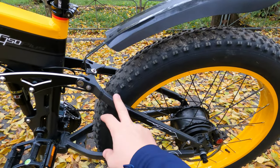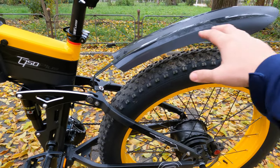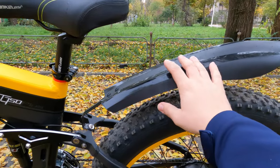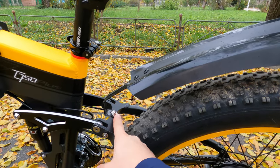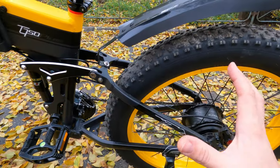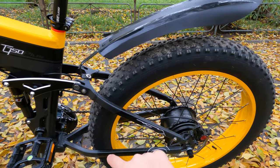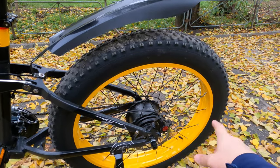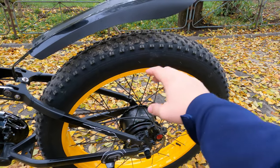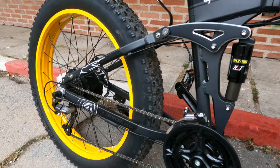So they integrated these two, and you can find special racks that have their own fixing legs that will sit above that. And of course they also added this mudguard that has another added fixing point here, and you also have a fixing point there. So if you want big mud protectors, fenders, or call them how you wish, you can actually install a big arching one, and then you can fix it from here with wires around the rear wheel, so you are going to be fully protected in bad weather.